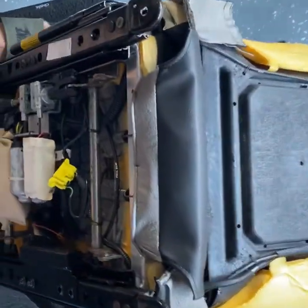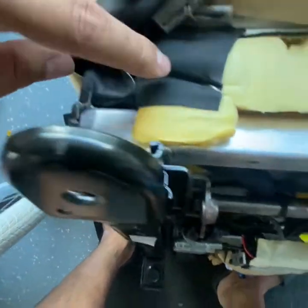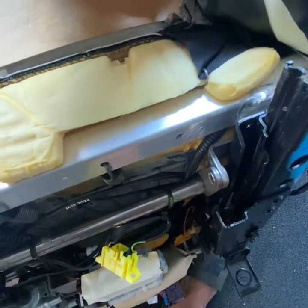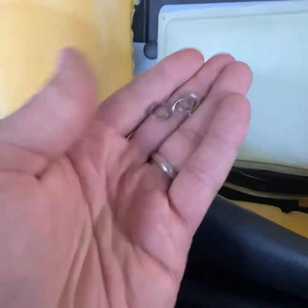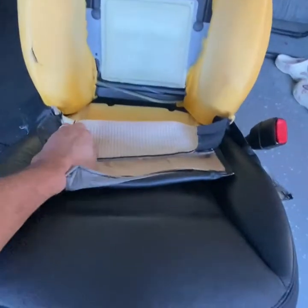With the lower cushion all you have to do is peel it back - but of course I forgot there are a couple more ring clips: one, two, and three, four - they have to be removed to actually pull the cushion off. Once you peel back the seat you'll find more upholstery clip rings in this area. Take your time - there are four on each side - and release them using the side cutters.